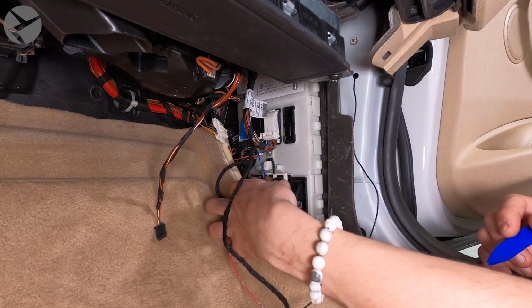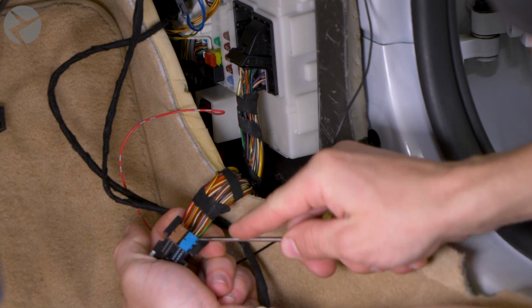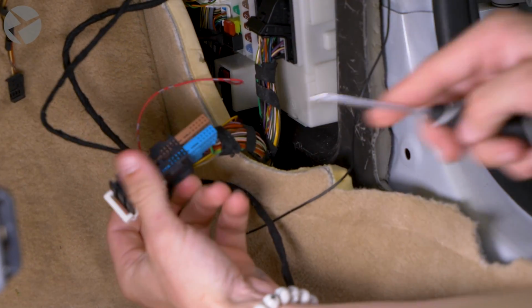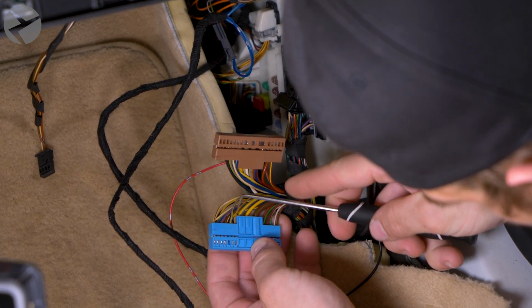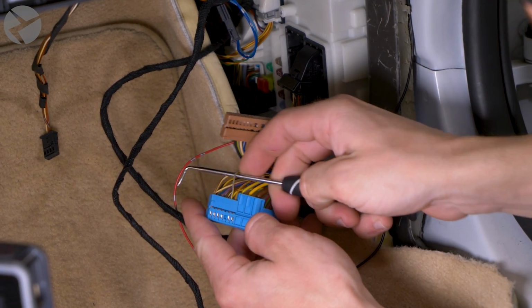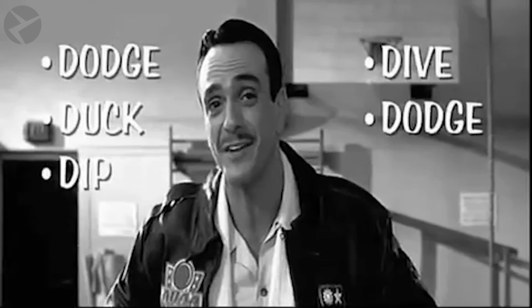Press the tab, rotate the arm, and remove the two connectors. Open the sides of the sleeve to free the pin retainers. On the blue retainer, locate wire 22, which is the yellow wire with blue stripe. Implement the TPPB method: tension, poke, poke, bend.